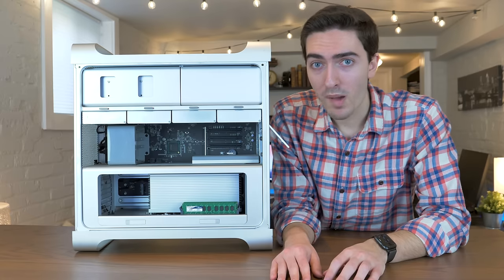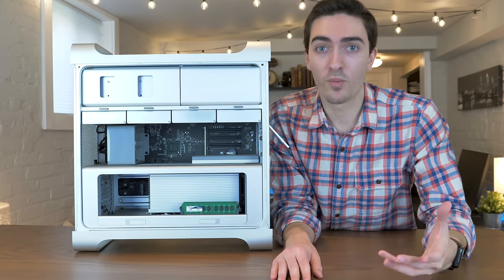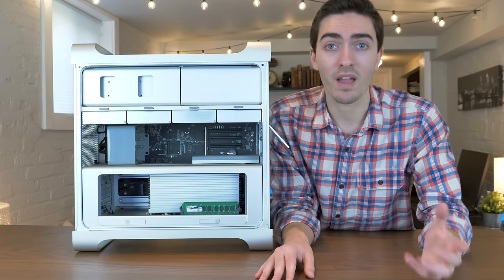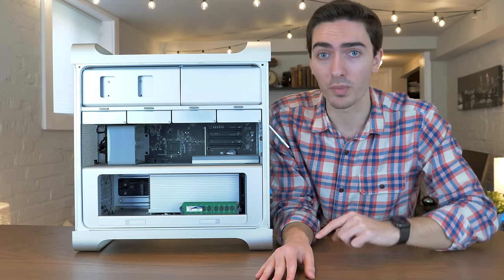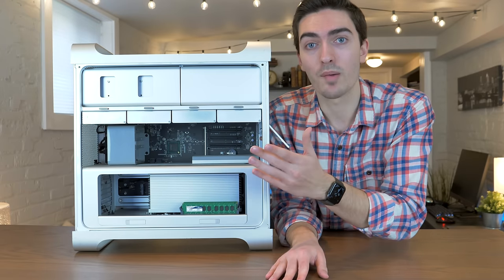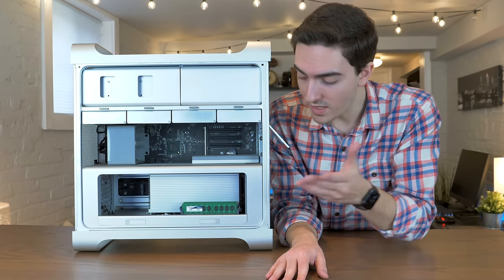Now, if you do buy a 4.1, you'll want to flash the firmware to 5.1. It's very easy. It's just a simple tool that you can run. I've got a tutorial linked in the description below if you need help with that. The first thing that we're gonna do now that the SSD is in is upgrade the processor. So that's a pretty simple task.